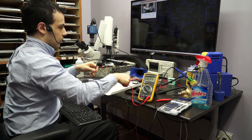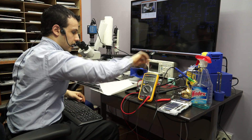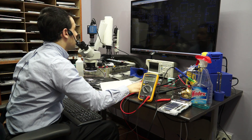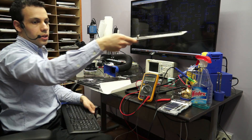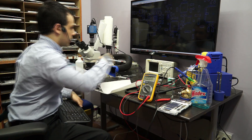Backlight enable measures at three volts — confirmed. Now the next thing to check, since it's telling the machine to turn the backlight on, is the PWM signal. The PWM signal is what tells the machine what brightness to set. If the PWM signal is too low or not present, it's not going to turn the brightness up, even if the LED boost circuit is actually working.